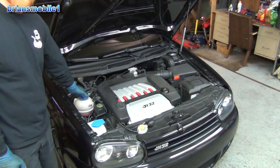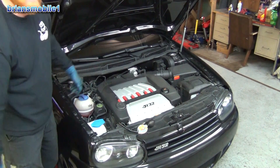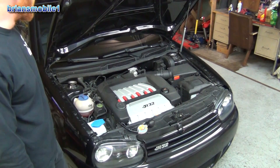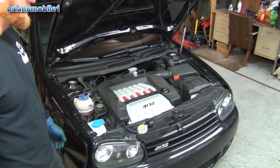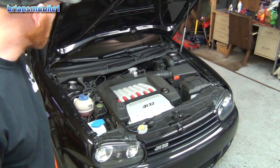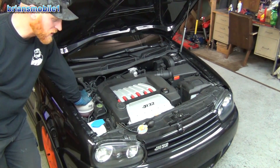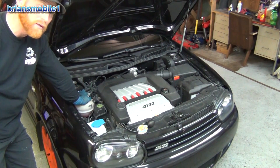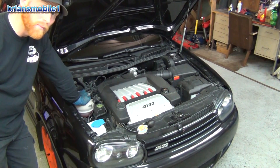Make sure this is full. If you have air in the system, it's the antifreeze running through the heater core that gives you your heat in the cabin. So make sure it's topped off to the right level. It's important to change your antifreeze — if you've got the green ethylene glycol, it's usually a good idea to change it every three to five years. If you have propylene glycol, it's often good for about 100,000 to 150,000 miles.